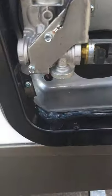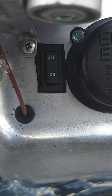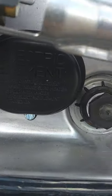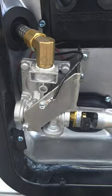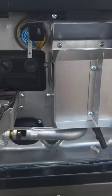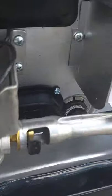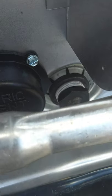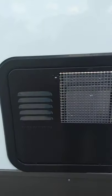This is your water heater — it works on both gas and electric. There's a rocker switch here; behind this cover is an electric heating element and that switch operates it. To turn it on electric you flip that switch in the lower left-hand corner. Always make sure there's water in your tank before you turn it on. You can also run this on gas and the switch for gas is inside. That's your drain plug — takes a one-and-a-sixteenth inch socket to drain it. Always bypass your water heater before you winterize so you don't get antifreeze into the water tank.